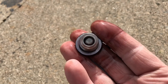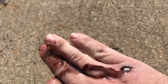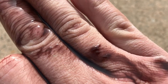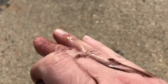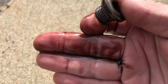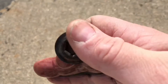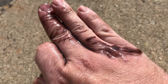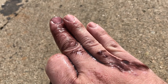While that's draining, I wanted to show you the condition of my fluid. Obviously it's not red like it should be, though it is a lot better than it used to be since I've already done one drain and refill. This car has 127,000 miles on it, so it's been due for a transmission fluid drain and refill a few times — that's why we're doing this procedure.